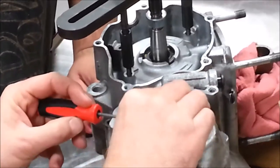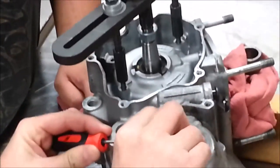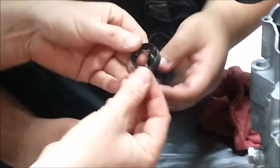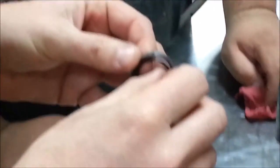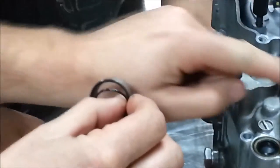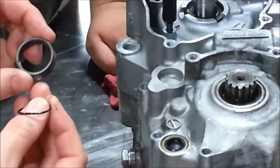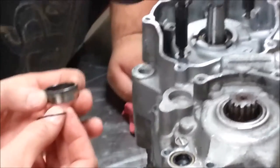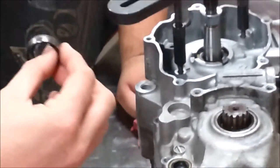So they went ahead and pulled this off. The spacer itself is directional — it's got a groove in here for the O-ring. When this is fully assembled down there, that pushes the O-ring down to help seal the oil from coming past these splines. If you were to try and put that on backwards, you'd just smash it. So this is a directional part, and a lot of people forget that.